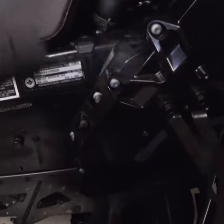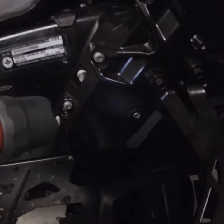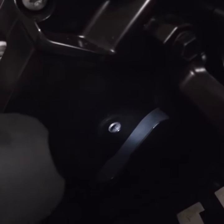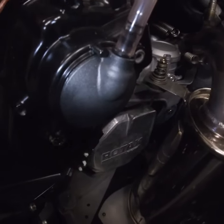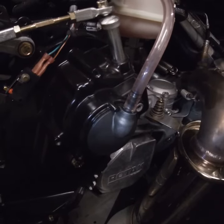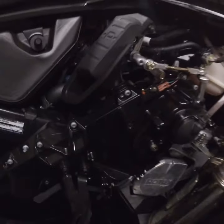Moving back up top, that is the sight mark plug right here. Looking at the chain case, there's the back edge cover — it's right almost in the center, just below the lower peg mount. That is the plug you want to take out — it's the sight plug. When you fill, you're going to watch that mark until fluid starts to come out, and at that point it's full. I'm going to pull that and show you, then pop the side cover off for the fill tube. The sight plug is out — obviously there's no fluid coming out since we drained the case.